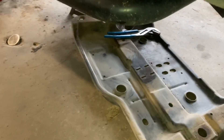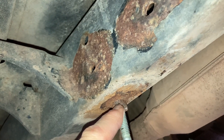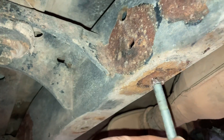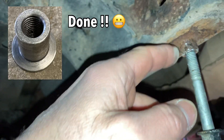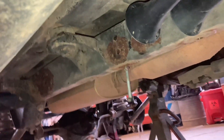Talking about unexpected but expected things — when we removed the crossmember, the transmission support, there is a nut insert on the frame to hold the crossmember. There are three of them, and the center one just decided to die. So we have to take that off and replace it. We'll make a little sleeve with a flange that we're going to tack weld there. But this is one of those little things that happen and slow everything down.